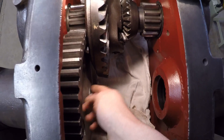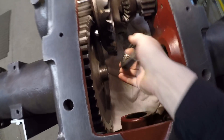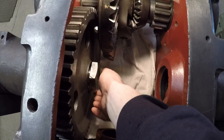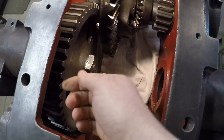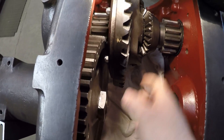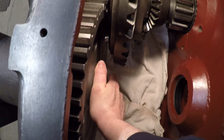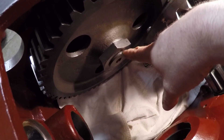I've got the carrier placed back where it needs to be, axles in, and this bull gear is just loose on the splines, so I'll slide it on a little bit here, take the nut and start it on, run it down to see if it improves our fit at all. Two major questions: is the bull gear going to tighten on the splines without contacting the case, and what is my clearance between the carrier bolts and that bull gear? Just run this down as tight as I can get it by hand — I can tell I have more threads exposed, so I know the bull gear is further on the shaft than it was.